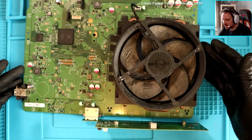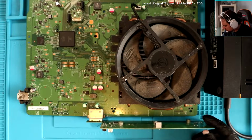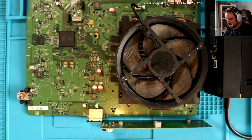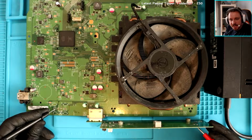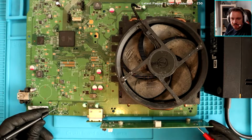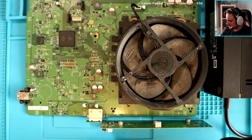And obviously the console doesn't turn on. It just gets like a bit of a power surge until you turn it on, right? That's not turning it on. So why is it not turning it on? That's the question. The LED works, by the way, because it's turning on. I don't know if you can see. The LED turns on. If I go from here, which is power negative, to positive on the button, the LED is on. I'm using this to bridge it, and when I'm bridging it, I get a light, but it's very dim.